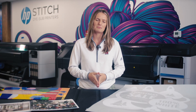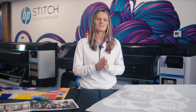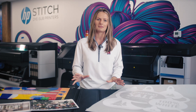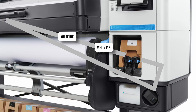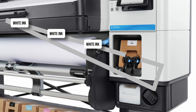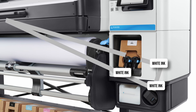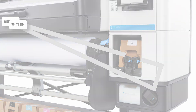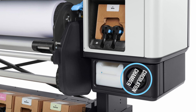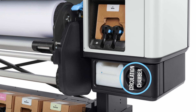That is exactly what HP considered and changed when they released their latex printers. HP's white ink solution is different from anything else on the market. They use a circulation system, which constantly moves the white ink from one cartridge to another, keeping the ink fresh and ready to use. To eliminate waste from the printhead cleanings, they have a circulation chamber where you can insert the two white printheads when they are not in use. You would then insert auxiliary or dummy printheads into the carriage.